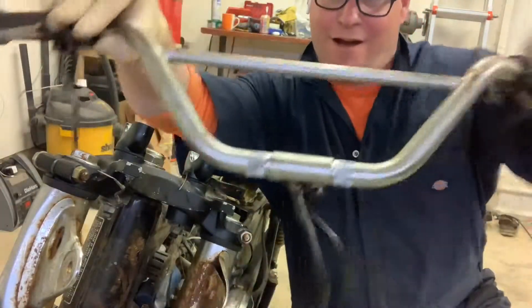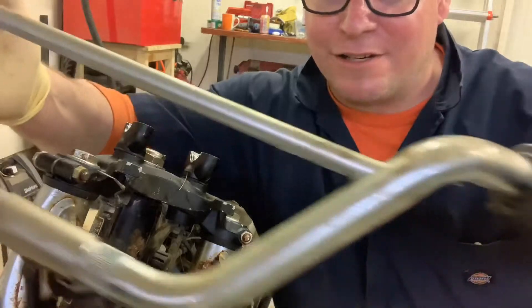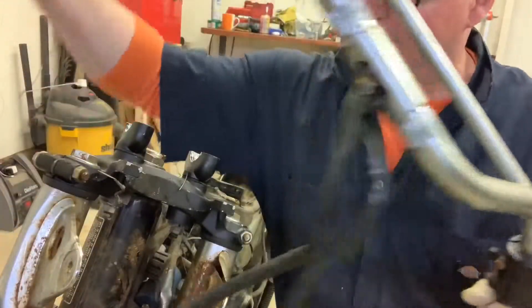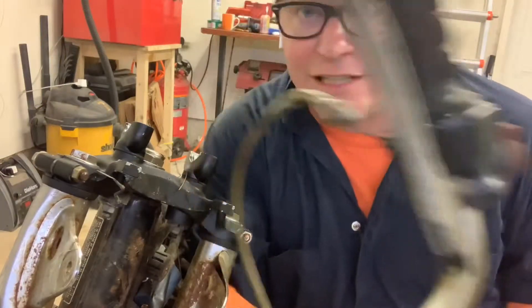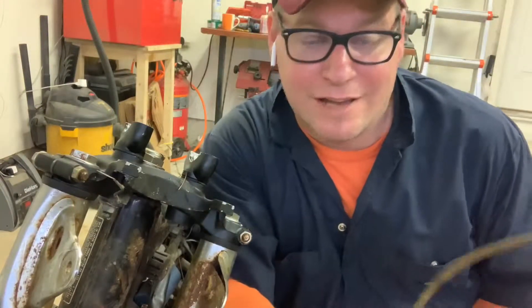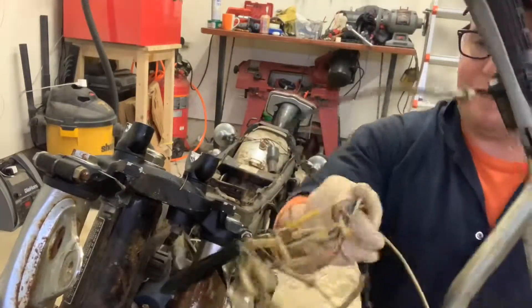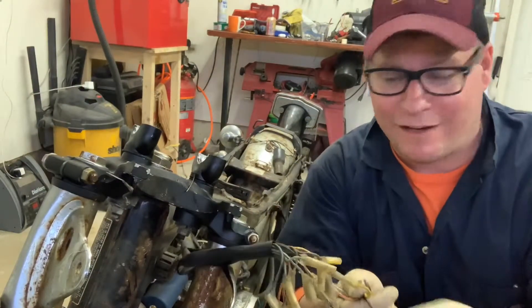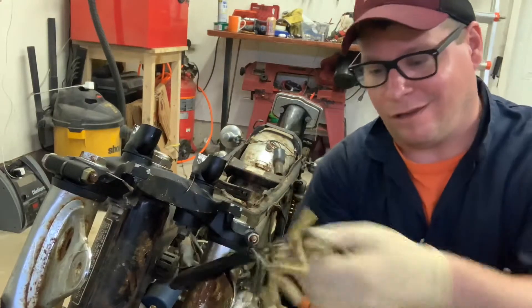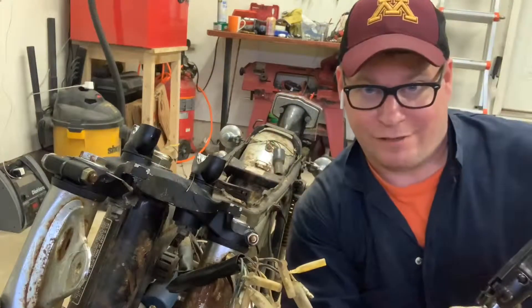From here these bars are going to lift right off. These CL handlebars aren't in the worst shape — I think they're actually going to clean up pretty darn good. Still got my throttle cables connected here through the throttle, so I'm just going to leave it for now. We're going to take the bars out — the bike is starting to clean up. We can also just disconnect any additional wiring that's here, just pull it off. We're going to find a wiring guide later on and plug it all back together. The handlebars are free — actually, they're not free, they're for sale.